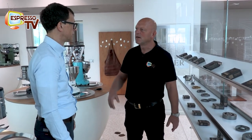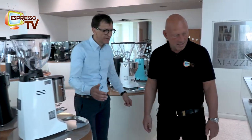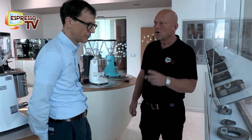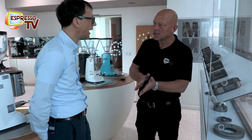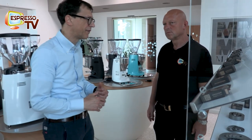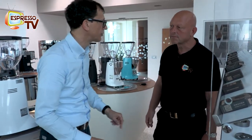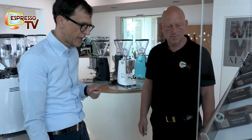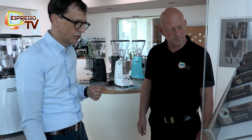The Coni for me is preferable because it's not so big. The Robur is more for high performance - very busy locations like 500 coffees per day or even more. And with the Robur you can change the damper inside depending on the situation: if you have dust or very dry weather and want to control grinds on your counter, there's a dedicated damper; if you have a clumping effect, you can change the internal wire damper inside the GFC system to solve any issue.